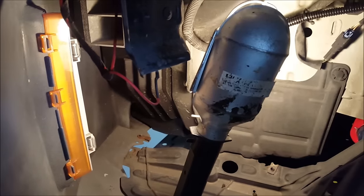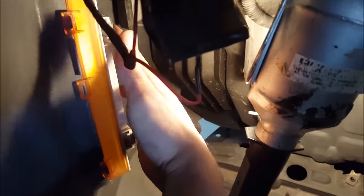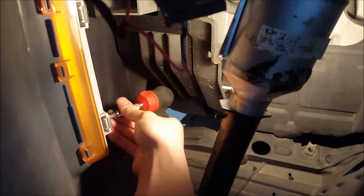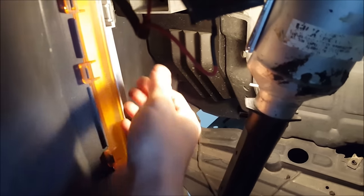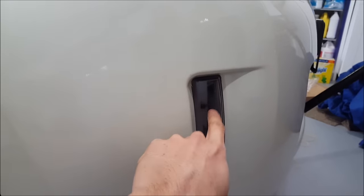We're on the driver's side now, and this is a lot easier to work with. You don't even have to pull this fender liner out all the way, you just let it drop down. To take out these reflectors, there are two Phillips screws — just remove those and this thing will pop out. On the passenger side to make life easier, in order to get this light out the reservoir is going to be in your way. What you want to do is remove two 10mm bolts that hold the bumper in — that way you can move the bumper away to get more clearance.